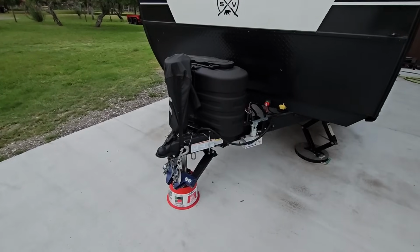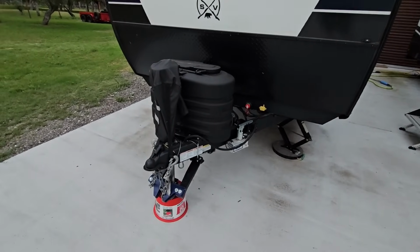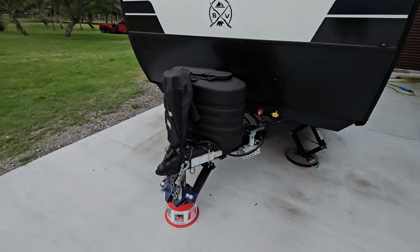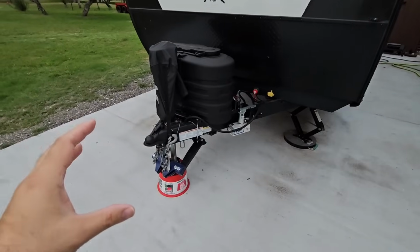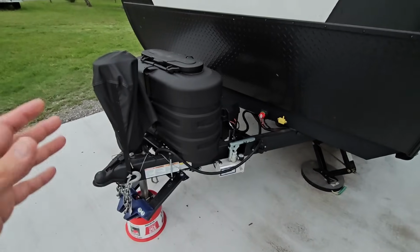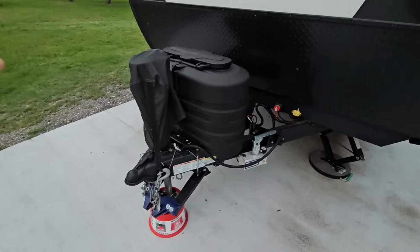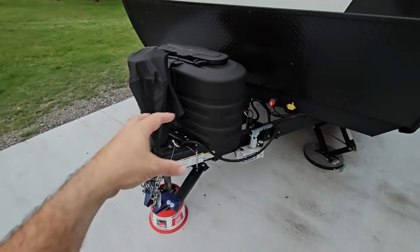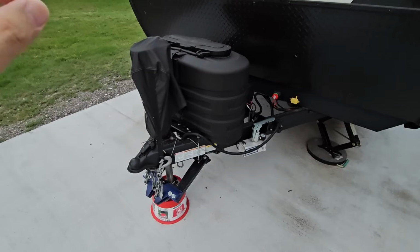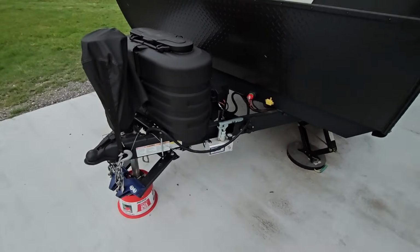It's kind of like if you have a motorhome and a towed vehicle behind you, sometimes you have to learn things you can do whenever you're towing a vehicle behind you and things that you can't do. And I think just getting yourself in the best possible scenario to avoid that excessive amount of downward pressure on your A-frame is really the key. So yeah, some hitches will give you easier ways to address it in terms of bleeding off pressure or removing that pressure without needing to disconnect the system to some degree. But all of them are going to require some type of adjustment before you go up those inclines if you want to avoid possibly putting too much force on your A-frame.